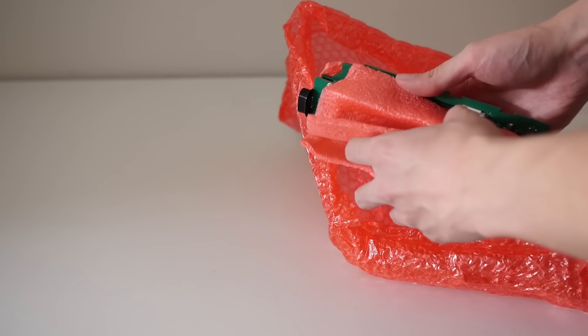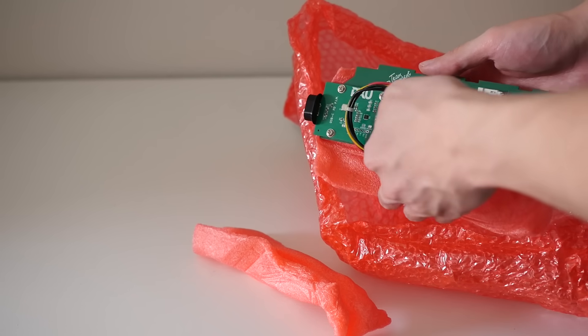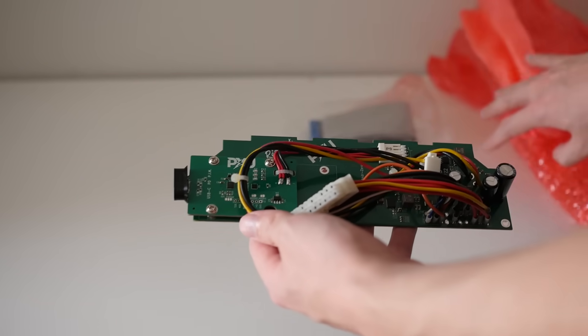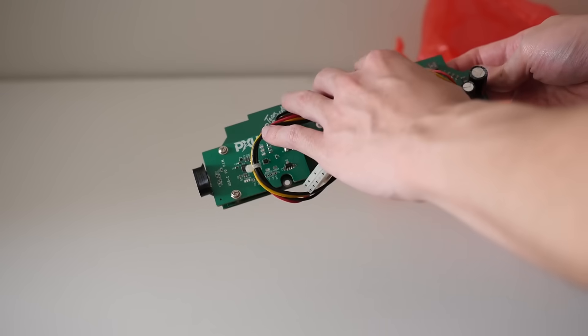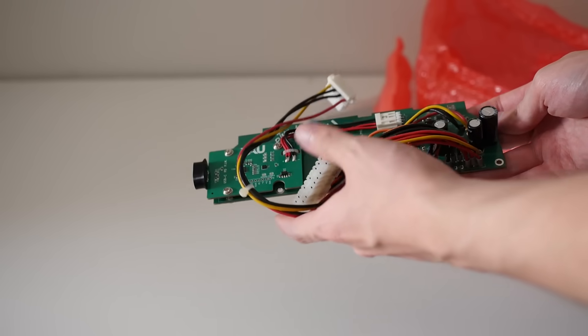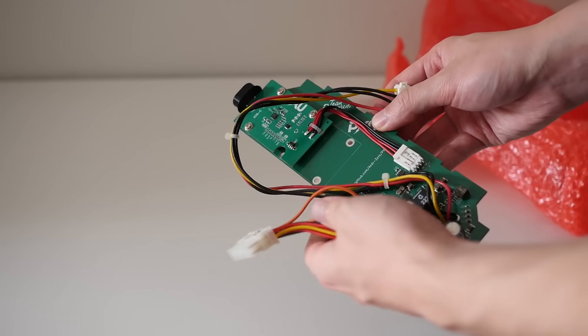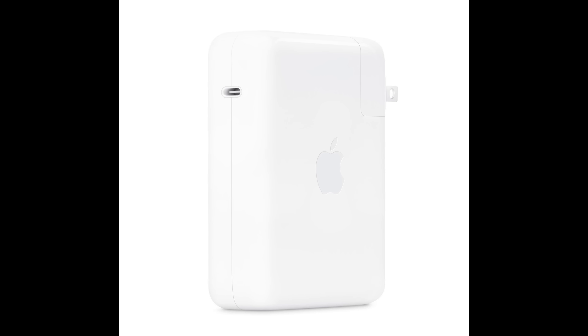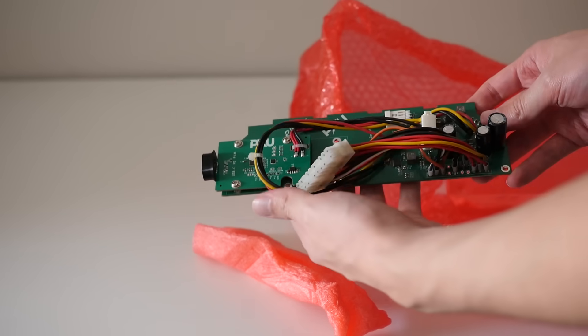Here is the new power supply. As you can see, it's a perfect fit for the original, but since it doesn't have to deal with AC power, the board is a lot emptier than the original. Depending on how you look at it, this is either a positive — because it'll emit less heat in the box and allows for more versatile power sources — or a negative, because it does require some kind of external box. But at least the external box can be a relatively standard off-the-shelf thing, instead of something proprietary just for the Xbox.